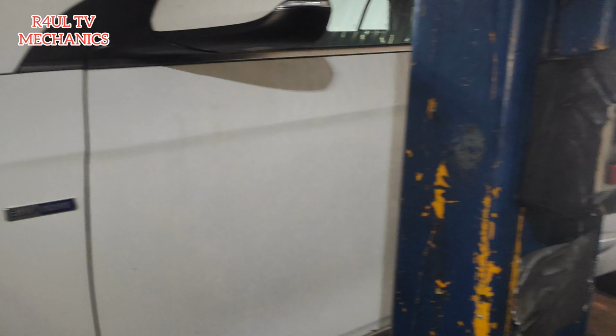Okay, guys, we have sent the car up on the ramp. You can't really get it wrong. It says oil filter cap, which is in here, and engine oil, which is in here. To take that off, we need a 10mm socket, ratchet, extension, whatever you've got. Take that one off, take that one off, that cover comes off. Take them three off, that cover comes off. And then first off, we will go ahead and drain the oil. We'll go from there.